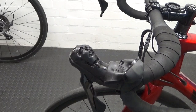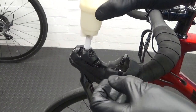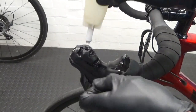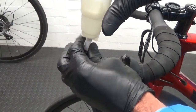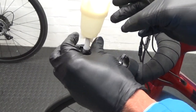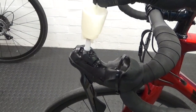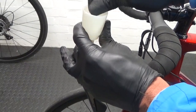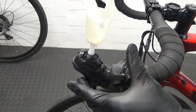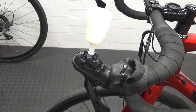You want the bleed cup with the road adapter on the bottom for the levers. Just screw that in, making sure the O-ring's on there as well — just literally nip that up until it stops. Then you can remove the cap off the top. There's a plunger in the middle there as well — that just pulls out. That has to shut to stop the fluid, so put the plunger back in. You can remove that as well and put it to one side.